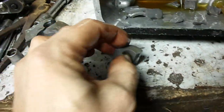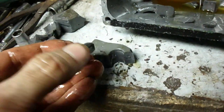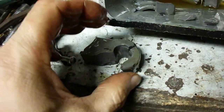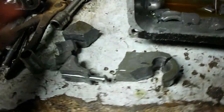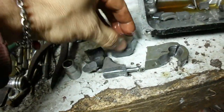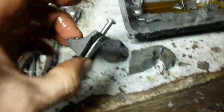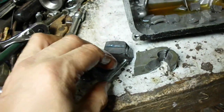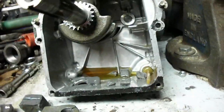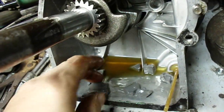Here's the piston pin area — another part of it there. It didn't break it quite as badly as the first time — kind of fits together like this. But as you can see, it broke in the same spot again, right where the main bolt is. It did a bang-up job on it — there's no repairing that rod. Time to start over.